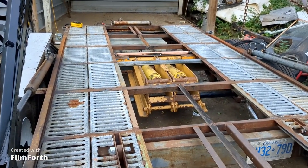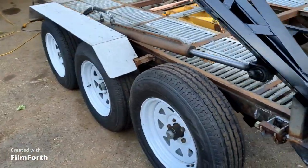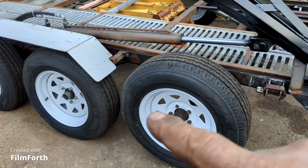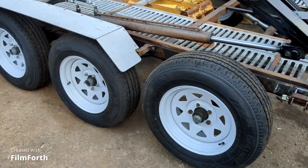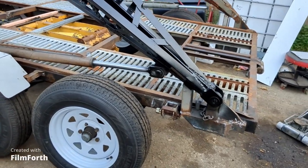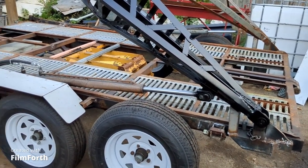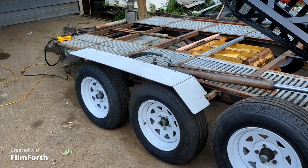When I do blast it next time I will powder coat it - I'll take it to the Mennonite and get it done because this guy does an amazing job. Nothing better than powder coating, like these rims right here - those rims are powder coated. You can get right into the crotch between the outer ring and the inner hub area, and the static electricity will draw it right into that gap. Yeah, I'm coming around the bend - it's basically almost got what I want done fabricated, so it'll be nice to have it finished. The Swiss army trailer.